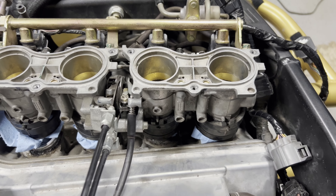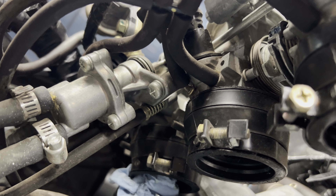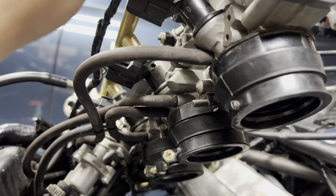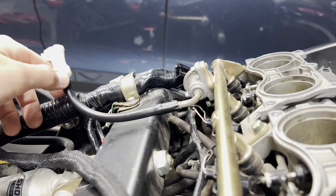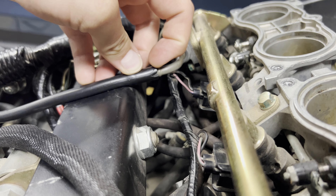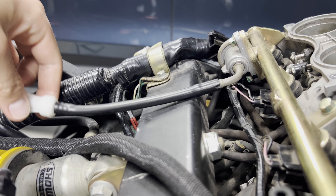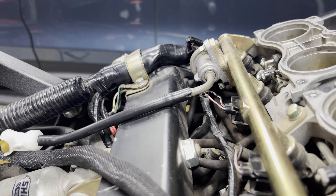Some of the insulators - the one on the end and one with two that were off - are supposed to line up in the notches. I already fixed those. On one vacuum line you can see a little bit of brass sticking out right there; if that's enough to cause an issue that might be doing it. I'm going to pop them off, chop the ends, and get some nice fresh ends to secure to. I'll throw a little motor oil on the insulators and clean out around here while I have the opportunity. Also this fuel line has a little bit of a tear right here, though the barb is all the way down. I'll probably buy a whole new set of vacuum lines and replace that fuel line over the winter.